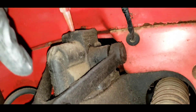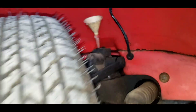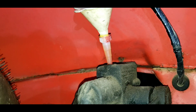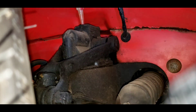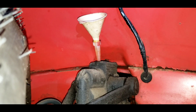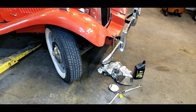We're putting oil in our shocks. This is the Armstrong lever arm shock connected to the upper part of the trunnion of the car. I've got the wheel turned and the plug out at the top and I'm adding a little bit of oil — it's going down very slowly. When I pulled the plug out, I got a mirror in there and there was no oil at all in the reservoir. I'm using 5W-30 synthetic; I think it's supposed to take straight 30. I can always drain it out. I sort of got this figured out.